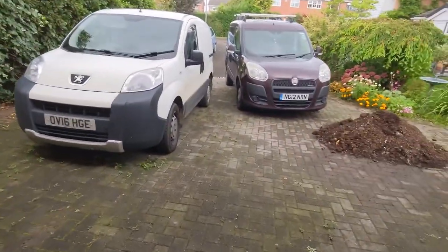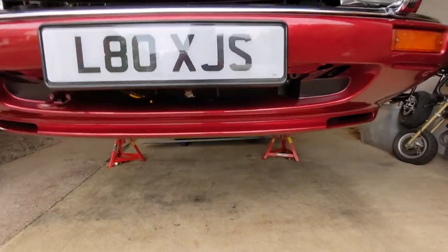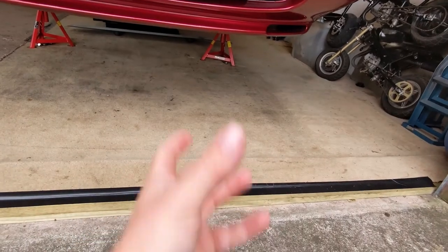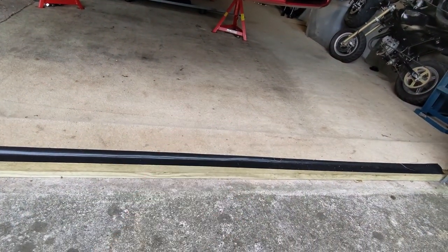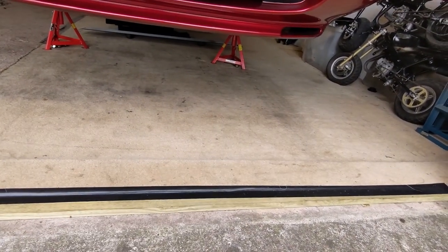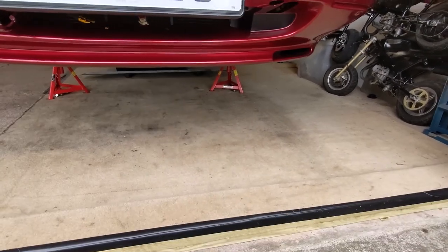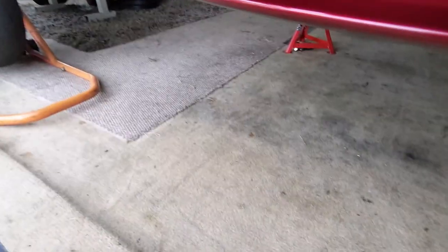After my little 7-mile jaunt checking the rear subframe, I got home and there was just water — well coolant, some sort of liquid gushing around here. A quick taste test confirmed that it wasn't screen wash, which I was kind of hoping it would be because that would be a lot simpler. But it was indeed coolant — the heat coming out would suggest that as well.